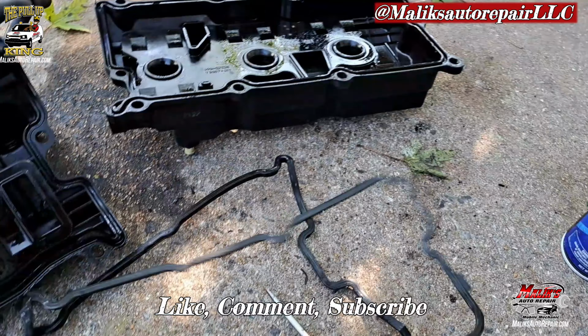All right, we took this hose off from here. I just took a flathead and pushed back on it. Popped right out. See, I got my 10 mils holding the valve cover. Yeah, got those loose. Top side, and we'll work on the bottom side. So once we got all the bolts out of the valve cover, it should be able to come on out. All right, man, we coming on up.